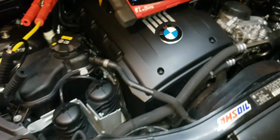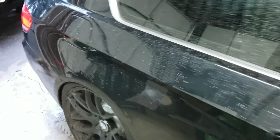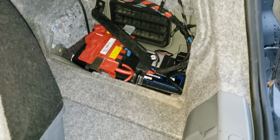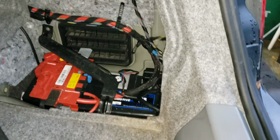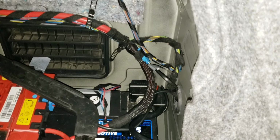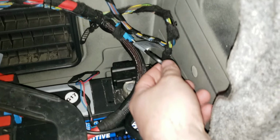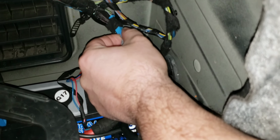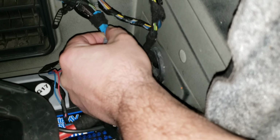I don't want to disconnect the coolant pump yet. Kind of using it as a guide. When I know that I've disconnected the correct sensor, that coolant pump should stop. Also, the customer states that he just had the water pump replaced. The other shop said that's why that trouble code is there. So, next easiest connector, intelligent battery sensor. Lives on the negative terminal. Here's the 2-wire. It does not share the same violet wire. We'll disconnect it.